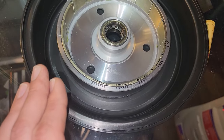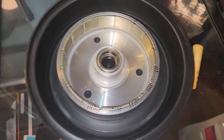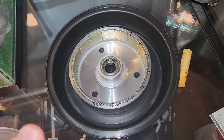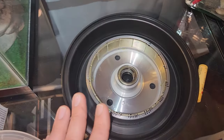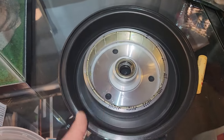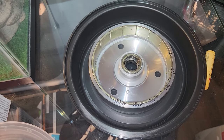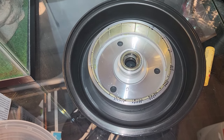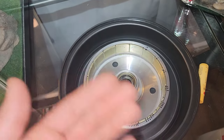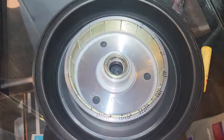What I'm going to do is probably take all the loose ones off one at a time, separate them, make sure they're not going to slam together or onto something else, metal or whatever. Clean it up, make sure there's no residual residue, clean where it's mounted, and then one by one, re-glue them with high temperature JB Weld. And I don't know if it'd be worth clamping them down even with a small clamp. I don't have that many small clamps, but we'll see if I need to do that. I'll let you guys know.